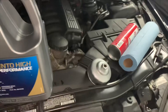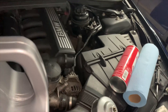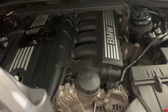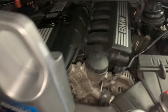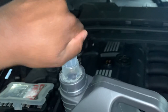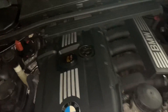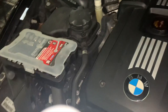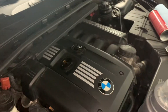The bottom is all tightened up now. Remember when you're tightening the drain bolt, do not do it too tight because you will squeeze the crush washer and you're going to need a whole new one and be unable to screw your drain plug in. Now it's time to add the oil. I don't have a funnel but the FCP Euro kit comes with one. This car is 6.9 quarts but I'm going to use seven because by the time it filters all the way down it's definitely going to use about seven. I'll set the camera down for a second since I need two hands.